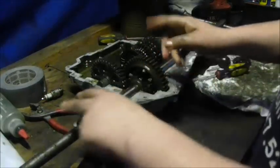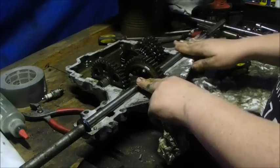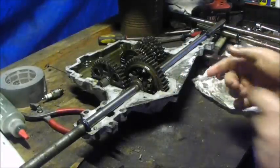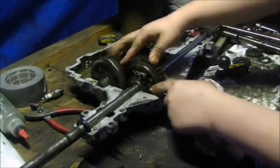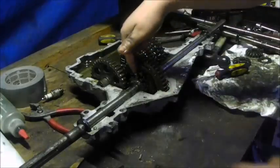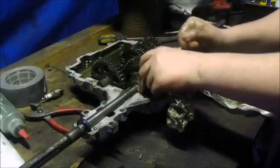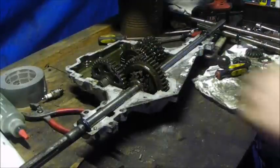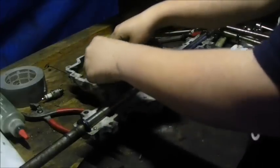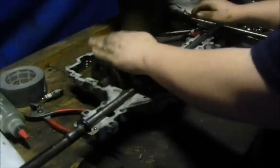I would say put all three or four gears in without this axle, and finesse it together until the spare gear on the right here lines up more or less very closely with the edges of this gear here, okay? And then gently and carefully pick it up and slide the other one in. And just double check to make sure these axles are not going up.